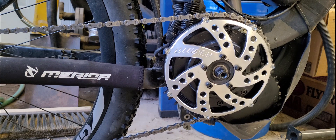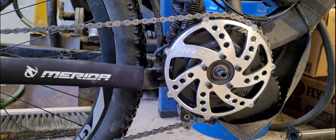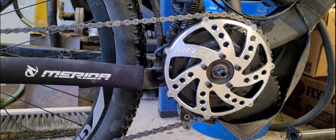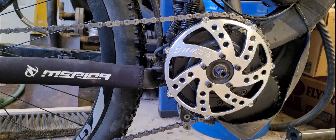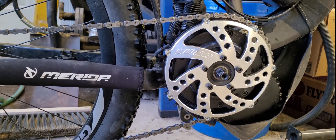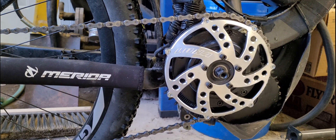I'm going to be doing a range test on this 20 amp hour battery. I want to run the bike right from 58.8 volts down to when the bike shuts off — it should shut off somewhere around 45 or 44 volts. It's still going to be over 10% charge, so it's not going to really hurt the battery hopefully. The battery's considered dead at 42 volts and the bike should shut it down before that. I tested it and it's 15 amp hours actual, so we'll see how many actual amp hours I can use — it'll probably be about 20% less than that.